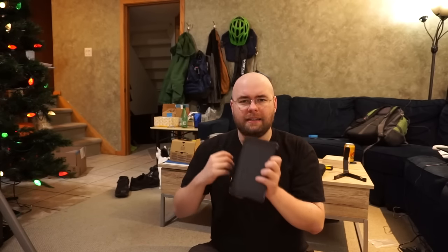It shattered the screen and destroyed the digitizer. I've replaced the screen and digitizer, but unfortunately in the process of repairing this tablet, I damaged one of the connectors on a daughterboard, and now it has basically a horizontal line that goes across where the touch screen doesn't work.